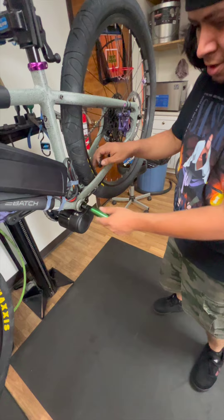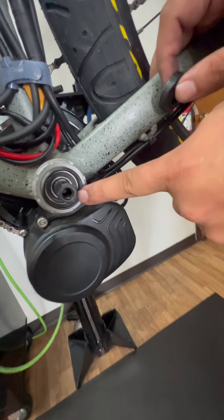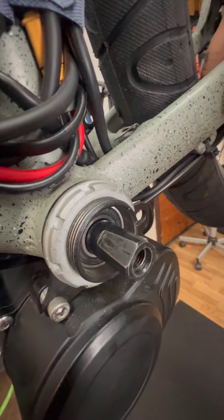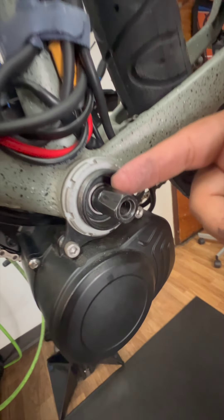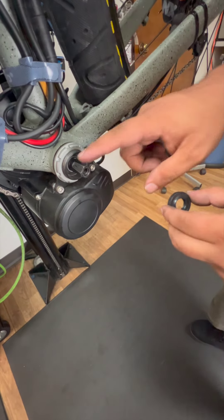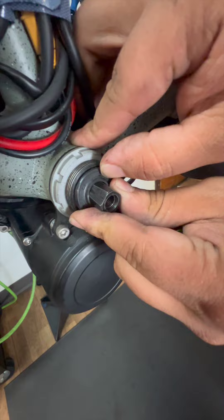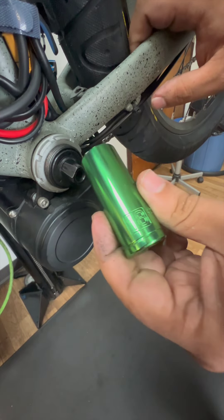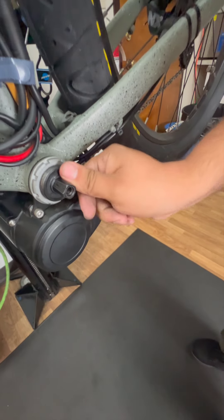So I'm getting ready to install the gasket. We pushed in the bearing, and you can see there's actually enough space to slot another bearing in there if you want to ride two bearings — that is totally acceptable as well, except you're going to have to figure out a different waterproofing system. So I'm going to slide one bearing in there and then put the gasket in place, which is super easy. I just used an 18mm lug and pressed it in place. Done.